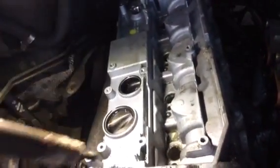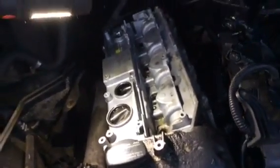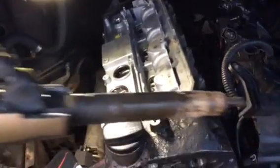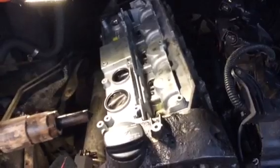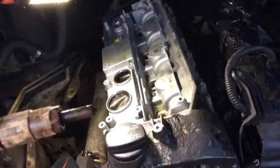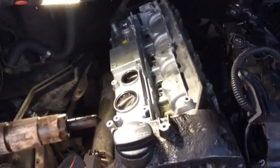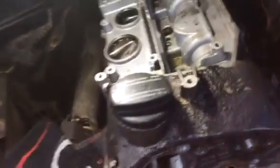And the injector should slide out, and it should bring with it a little copper washer on the bottom. We can see here it's not on the bottom of this injector. It must still be in the little injector chamber, so that'll have to be hooked out, and you have to clean the surfaces at the bottom of there. You need a good tight seal when it all goes back together again, with a bit of ceramic grease as well. Those injectors are pretty expensive, so look after them.